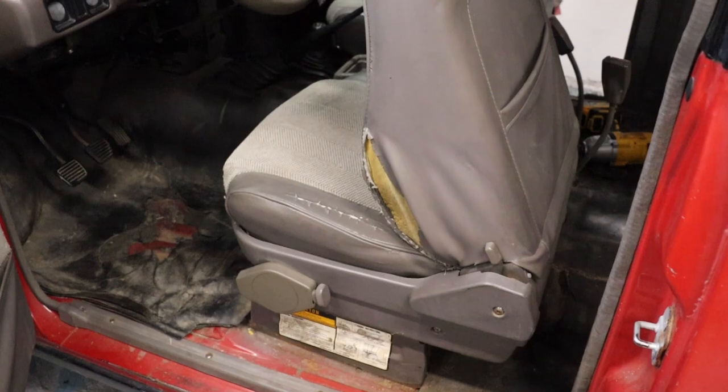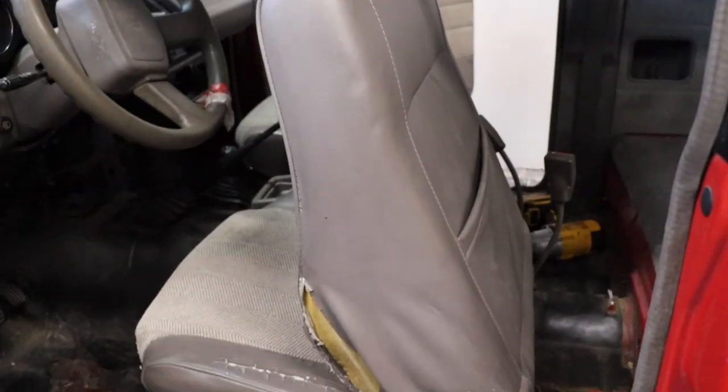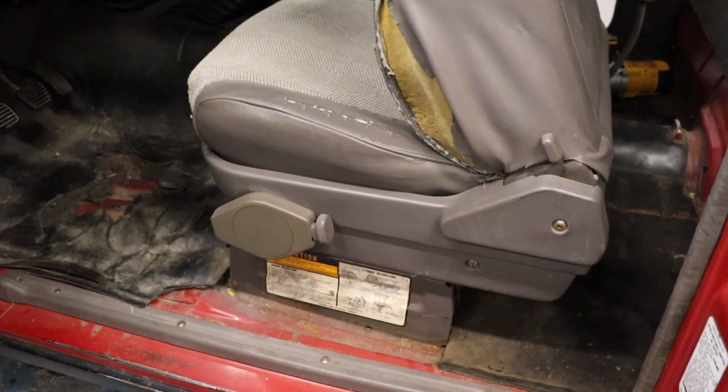Old carpet is out. We're going to start with the new carpet in the back and work our way forward. The back seat carpet area — basically the foot area — goes under the front seats, which have fixed risers that don't come up. So I'm going to remove the seats — four bolts hold them to the riser — and pull out the center console, which should unbolt pretty easily. Then I'll figure out how to cut that carpet so I can drop it in and have carpet right there on that seam. Four 12-millimeter bolts hold the driver seat; then we'll do the passenger seat and move them aside.